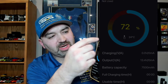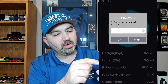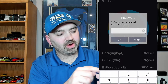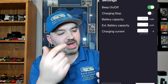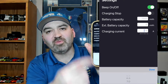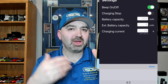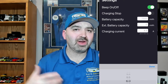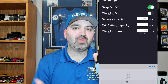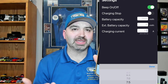The smartphone app allows you to change between 4.5 and nine amps of charging, gives you percentage of charge remaining, and shows output voltage. What's really cool — something I've never seen before — is you can change the charging current all the way from 4.5 up to nine amps. If you're using a cigarette lighter, probably around 4.5 amps; if hardwired, anywhere between 7.5 and nine amps.